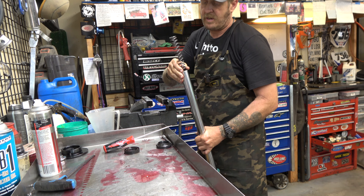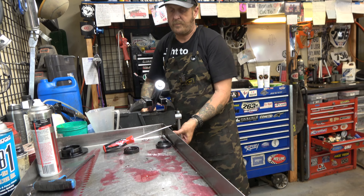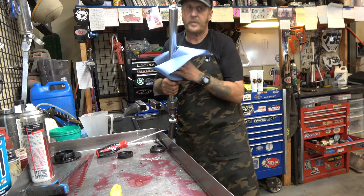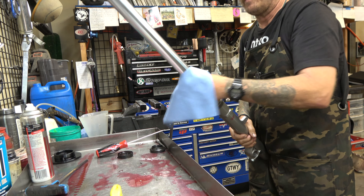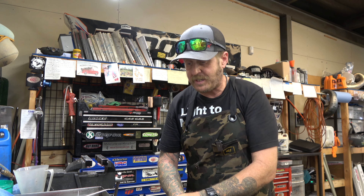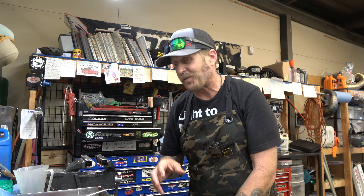Put our spring back in. Always push on them, make sure they're good, nothing hanging up in there. Thanks for joining me for that video, guys. Hope that helped — leave a comment below if it helped you get your fork seals done on your KLX 230 or any other bike. This is very different from modern race bikes, but it's very similar to a trillion old-school bikes with damper rod style forks from the 60s, probably the 50s, forward — all the way up until they started flipping forks upside down. Pretty simple. Great thing to do every now and then — keep the forks fresh, keep things moving smoothly, and it'll just help your bike work better. Thanks a lot, we'll see you guys on the next one.